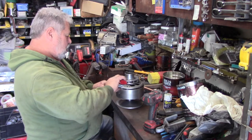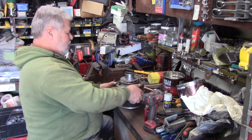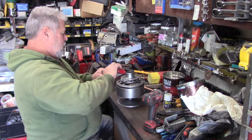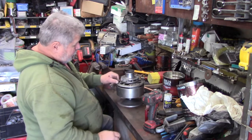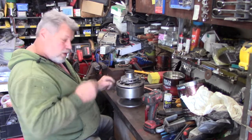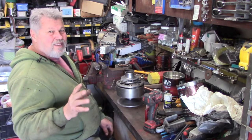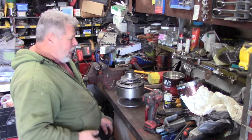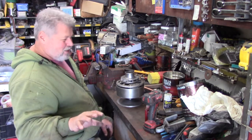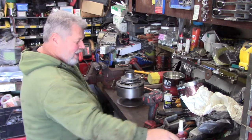Put some on this one. Unscrew the other bolt, put some on that one. Now I know a few guys — I should have taken a picture when this thing was running. It was so noisy. I tried to adjust the carbs, but I thought it was the valve train that was noisy. And believe me, there's a chain that drives a cam, and I looked and it was a bit more job than I wanted to do. So I said, it's running — don't fix it. I was going to wait on the valve train.